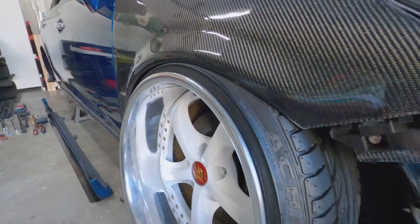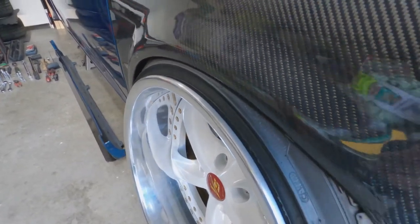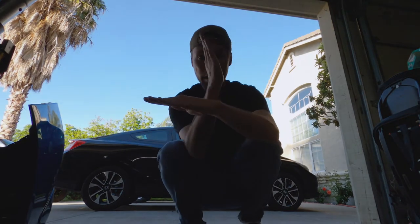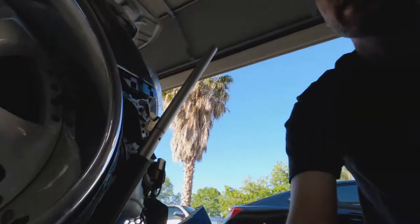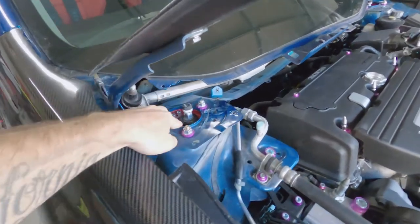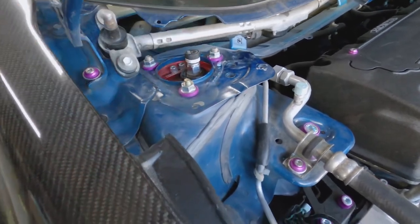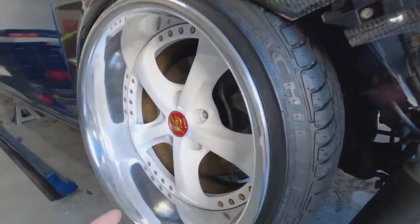There's a little dilemma I'm having with the fender with the wheel on. After putting the LCA extension on, my camber plates are already maxed out and I'm still hitting on the bead a bit. When you put the LCA on at the bottom it pushes out the strut as well, so that's what's causing me to hit right here. I bought extended LCA and camber plates so it'll give me just enough of a finger gap to push back and help a bit, but it's really not going to clear the bead so I'll probably end up having to slot the strut.